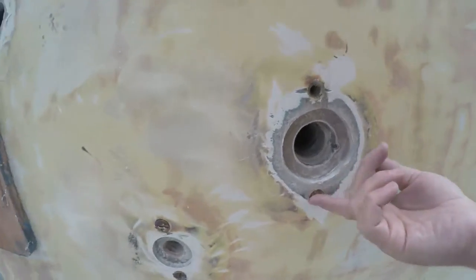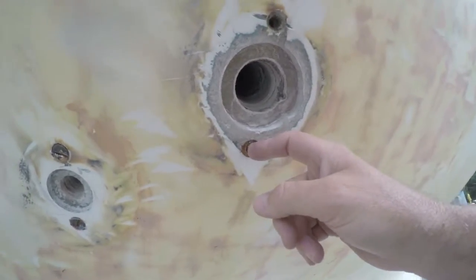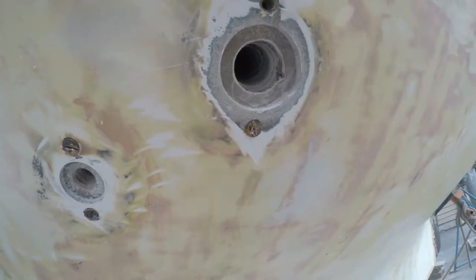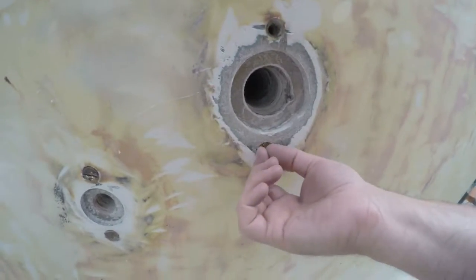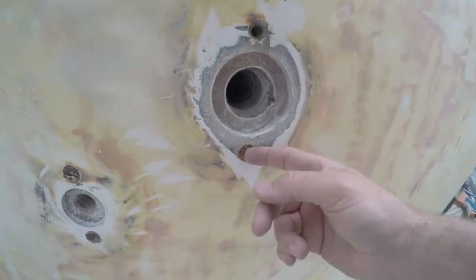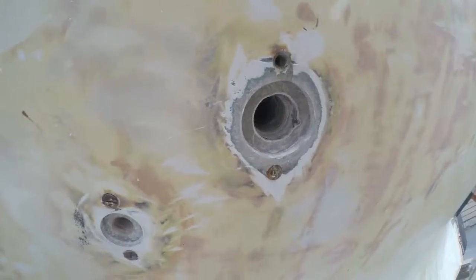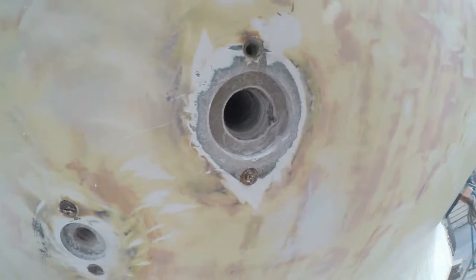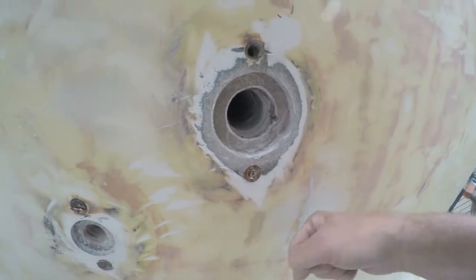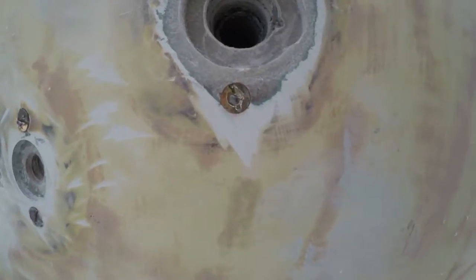For this one I thought I'd do the intelligent thing and drill it out. The correct-size drill bit I have wouldn't bite into the metal — I spent probably five minutes drilling and it wasn't anywhere close. Then I thought I'd drill a smaller hole and use an easy-out, which is what I did. I drilled a nice small hole, put the easy-out in, and put the drill in reverse to back it out — it was more than the drill could handle. So I put a wrench on the easy-out, turned it, and busted off the easy-out inside.